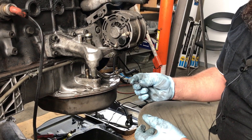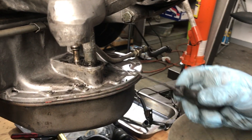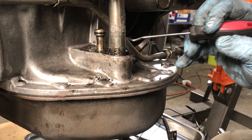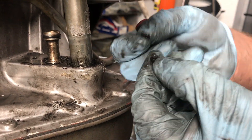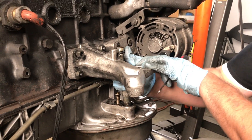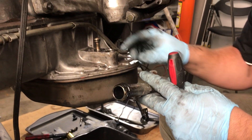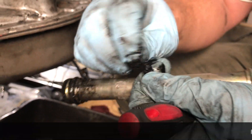I finally got it — I think this is the last piece to come out. What ended up being the ticket was a curved pick, working not against the tube outward but from the housing, digging down and then pulling it out that way. It's so darn brittle — I'm getting chunks like these that are just so hard. After getting that last chunk out, the seal is finally broken. There it is, and here's the rest of that seal — just unbelievably hard and brittle.